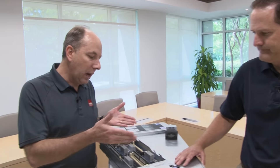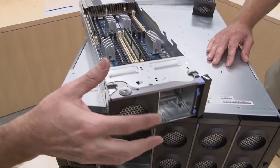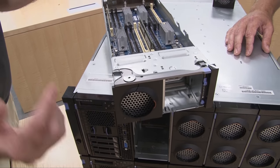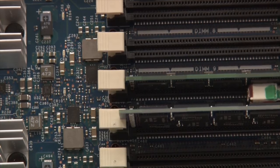So a significant amount of memory for a single system. The memory DIMMs all have a light path diagnostic capability, which means there are little LEDs next to each of the DIMMs. On the front of the compute book there is a small button here. So in the event of a DIMM failure, the light path diagnostic system will activate. When you remove the compute book with the failed components, you'll be able to press this button to power the LEDs, which will indicate which of the DIMMs failed. So it's a very easy way to figure out which DIMMs failed — remove it, replace it.